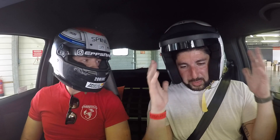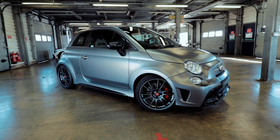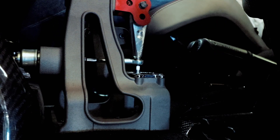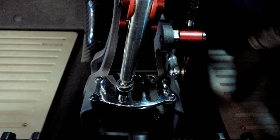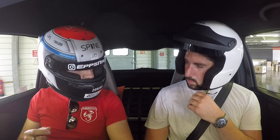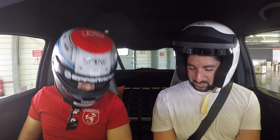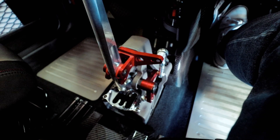Mike's with me for the duration of the day. I specifically wanted to do this video because for me, on paper, this is the ultimate 500 — the Biposto with the dog box. Mike, can you give us a bit more of an understanding of the concept of these boxes? A dog ring box is essentially based on gearboxes you'll find in a racing car — particularly older cars — but it brings some of that technology into a road car you can use on a circuit. The gears are connected by dog rings, so they're a little notchy, but it means you can shift pretty much without the clutch and very quickly. There's also a camera shot on it here which you'll see — it's a proper piece of kit, all the metals on show, lots of parts, it looks really racy.